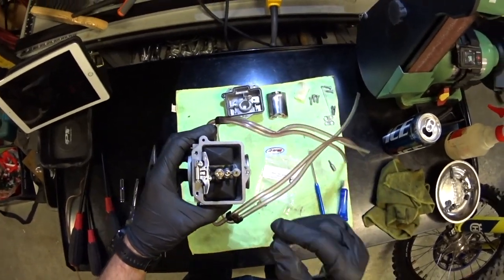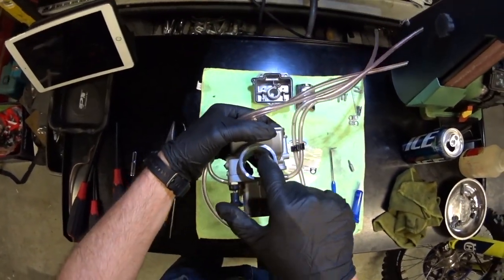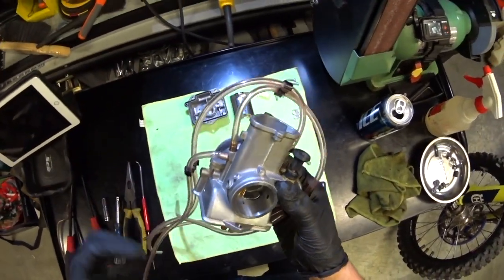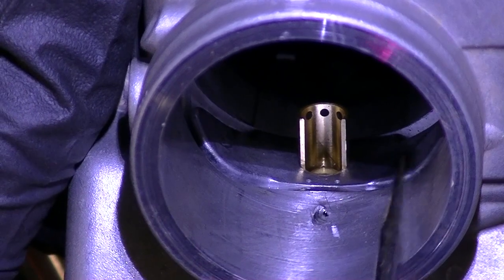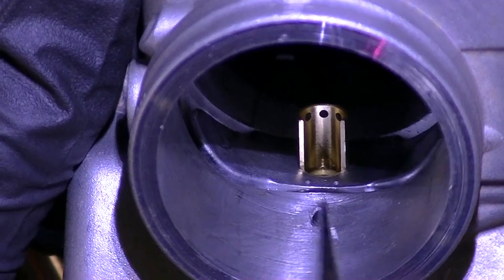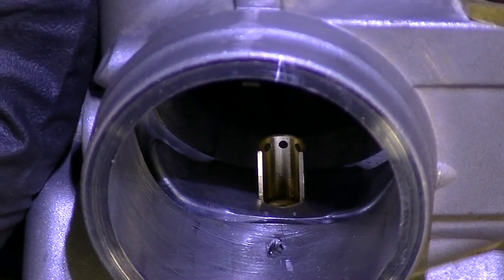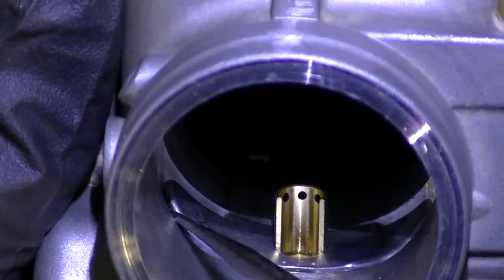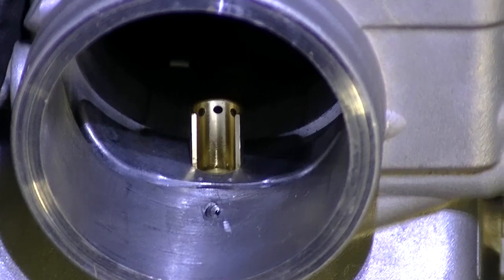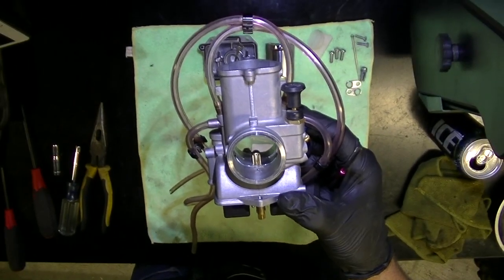What you need to do is actually take the float out to get to that gasket. There's a kind of horseshoe-shaped little thing inside there that you need to get out. You can see right inside there — it actually has a sort of dog bone shape to it, or a crescent shape. In order to get to that, you've got to take the float off and access a couple of Torx screws. I'll show you that in just a second.